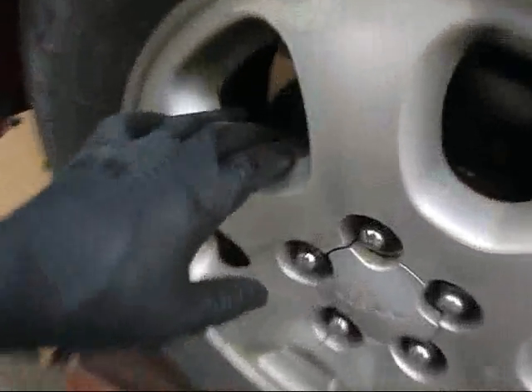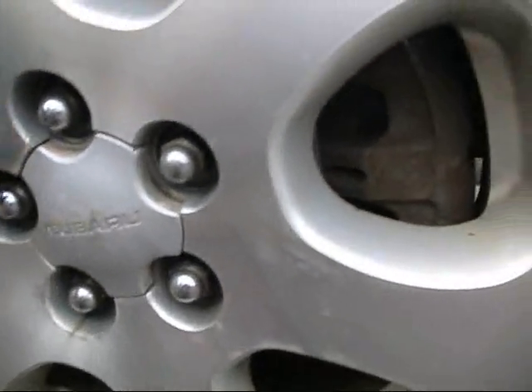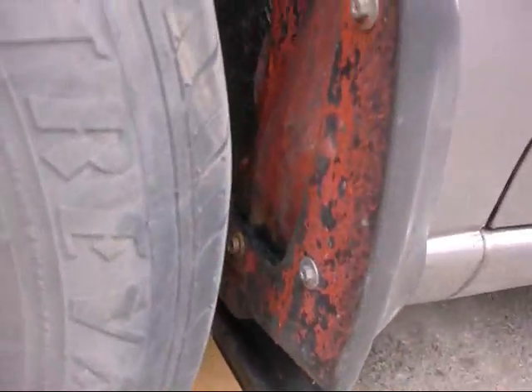Never any oil on the hinges and they close perfectly. I had the brake rotors buffed yesterday — I took the wheels off and buffed the rust off with a rapid strip disc, so the brake pedal is nice and smooth now. One of the bolts that holds the caliper on needed to be lubed up. I'm going to spray some black paint in there because it's red from somebody running over something, and I've been rubbing off the compound on the smooth paint.